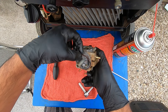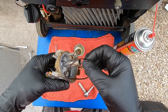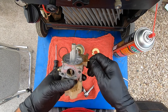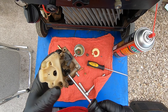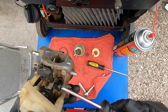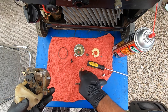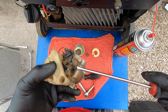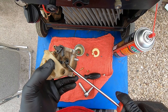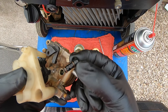If the o-ring looks like it wants to come out by itself, I recommend you do take it off for the next step. But some of them are so stuck and dry that if you try to pull it you'll break it, and then you'll have to order parts which delays your rebuild. Next you want to back off the screw — this is a stop for the throttle. Here's our last jet: this is our pilot jet or idle jet. Carefully pry that out and there you go.